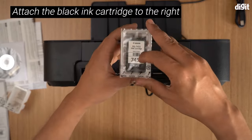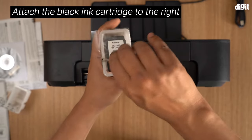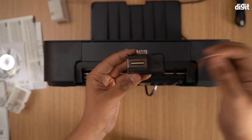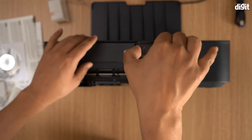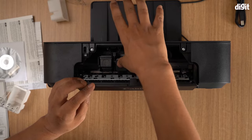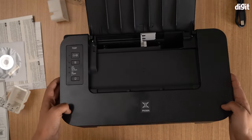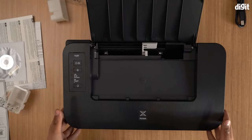I'm going to quickly install the black and white one. Again, pull up from the bottom to free the cartridge — it comes right out. Pull the little tab to free that end — never touch that end. Take it with this end facing upwards and slot it into the right side. Press it up gently. Now that's installed — go ahead and close that. Once you've done that it automatically aligns itself and makes a little noise.